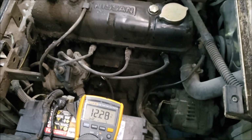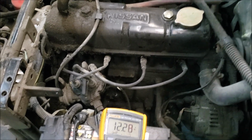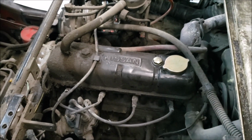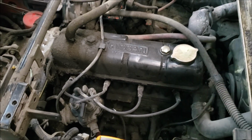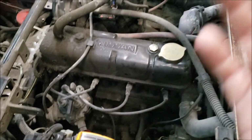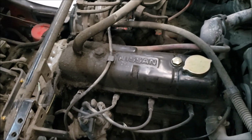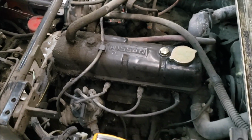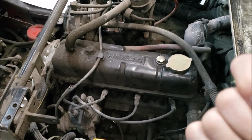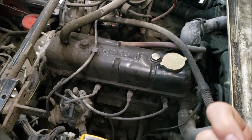Just solely on the drop that it did. The voltage from a fully charged battery, 12.6, it dropped down to 8 volts. That's what he said. True? Yeah. The story is incomplete because if the starter cannot spin, is it going to try to eat more current or reduce the current? It's going to jump up, right? Because at the end of the day, that starter is a motor. If the starter motor cannot spin, it cannot induce counter electromotive voltage, right? EMF.